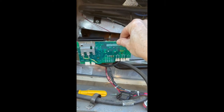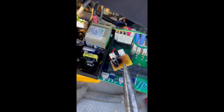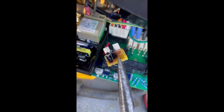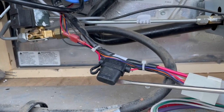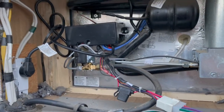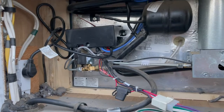Get under the control board and you'll see that 20-amp fuse sitting there. Go ahead and pull that out and see if it's okay — that was mine. The second fuse also located in this area is a DC fuse right here in this little box. You just pull that off and there'll be a fuse in there. I checked it and it was fine, but that might be another option too if the control board fuse is okay.